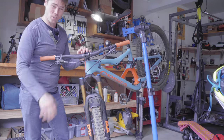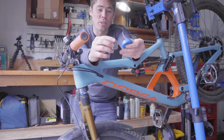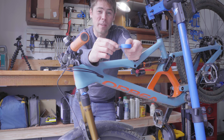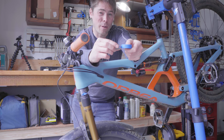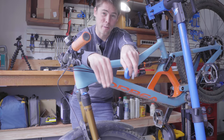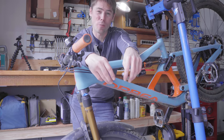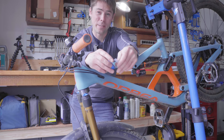The setup's more for trail riding so I'm going to dial it in for our local trail riding, which is a little bit faster and jumpier than your average raw natural trail. That means volume reducers front and rear. The bigger the volume reducer, the smaller the air volume inside the shock, which makes it more progressive — that curve is gonna ramp up sooner. I think I'm going to try a 0.8 right now, which is almost as big as you can go on that DPX2 shock.